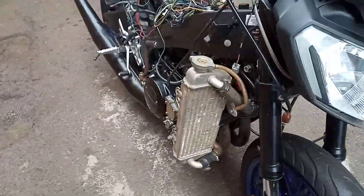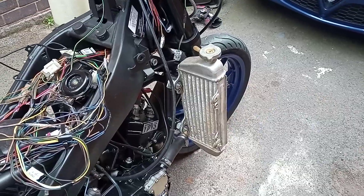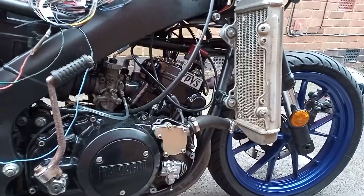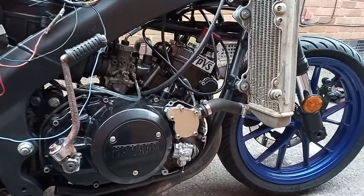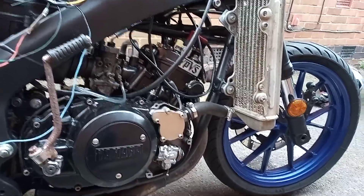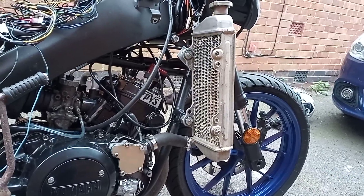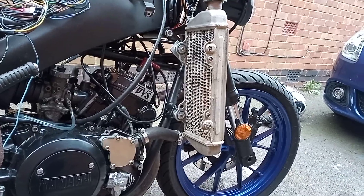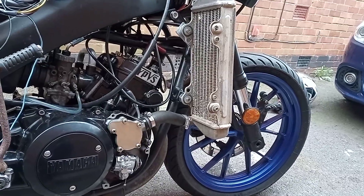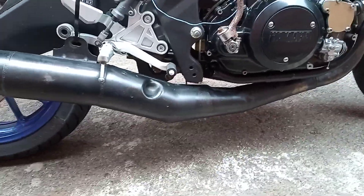Today Roger got bored with the wiring and decided to slave in this KTM radiator. It fits many different engine sizes on the KTM because they're an off-road bike. We filled it up, made sure the head didn't leak, and ran it up to temperature. It does a very good job - the temperature sender works a treat and nothing leaks. Going forward we're going to search for radiators that are about half the length, one either side, so it looks balanced. The plumbing works - it's not pretty, but we'll have to get better at that.